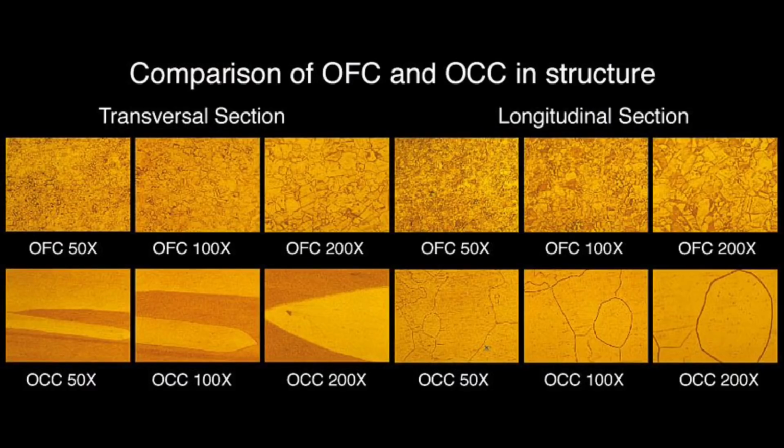The cables inside are OCC copper. For those of you who are interested in cables and believe it makes a difference, OCC stands for Ohno Continuous Cast. They're effectively a mono crystal construction. There's a lot fewer crystal boundaries and impurities than your typical oxygen-free copper, but they're also a lot more expensive, and it's unusual to find them in speakers at this price point.